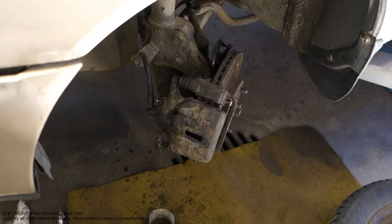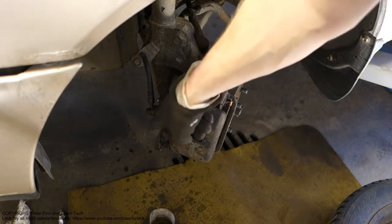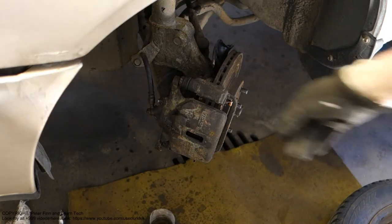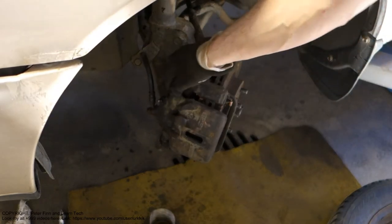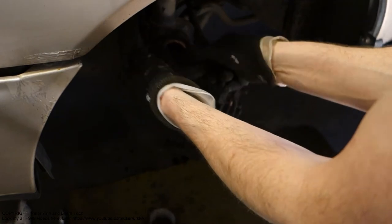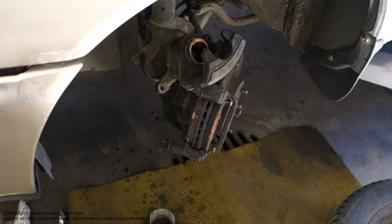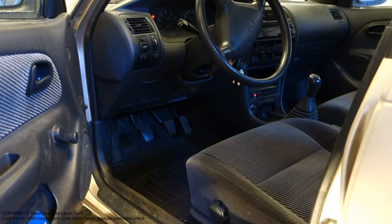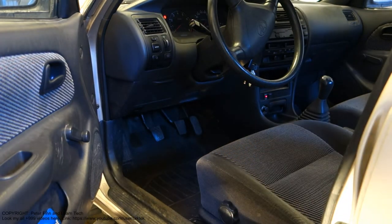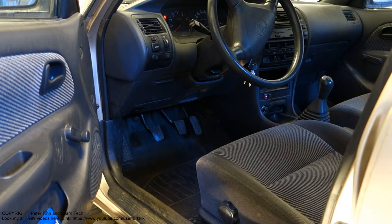Okay, and when I have opened these bolts in here, we can take this brake caliper out. And this brake caliper opening happens so that I take my brake caliper in here, and then I go to press my car's brake pedal, and then we look at that. Okay, and there is this car's inside area, and we look at this area where the brake pedal is, and it's our target. And then we need to press that brake pedal like 20 times.